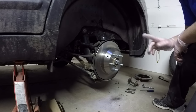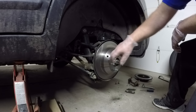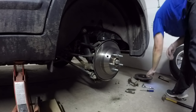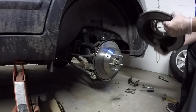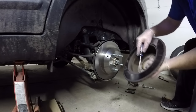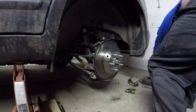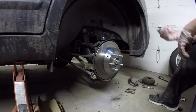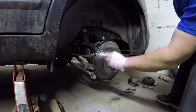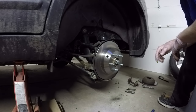There's one more thing - right there facing the camera, there's a little hole with a little rubber part we have to get off the old rotor and put back into the new one. So we grab the old rotor, take a screwdriver, go to the inside and just pop that part right out. It's just a little rubber cap sort of thing, and you just pop it right back into the new rotor.